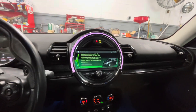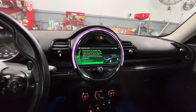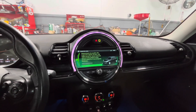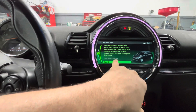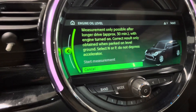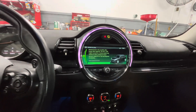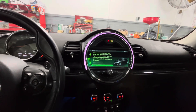Select the knob and push downwards on it, and a message will come up saying to drive for approximately 30 minutes to warm it up. You want to get it hot enough so that, with it idling in park or neutral, the Start Measurement button becomes illuminated. Right now you can see it's very dim — it'll become bright and then you can select it.